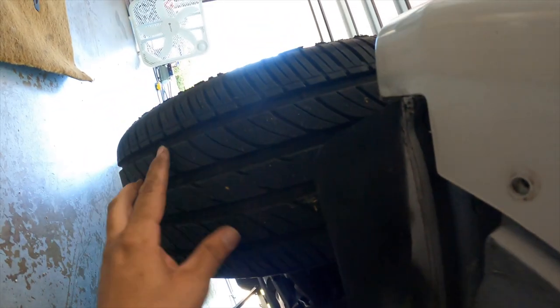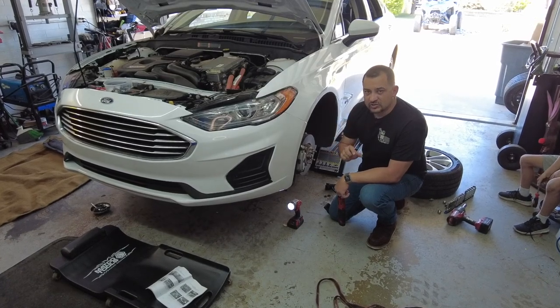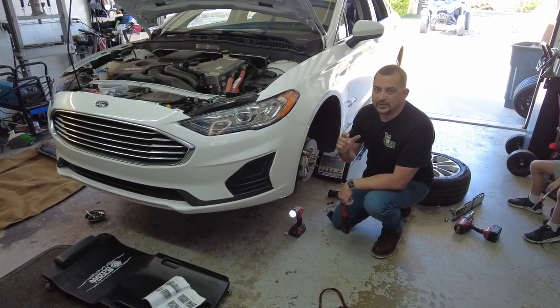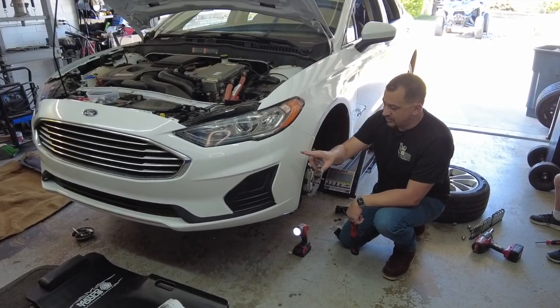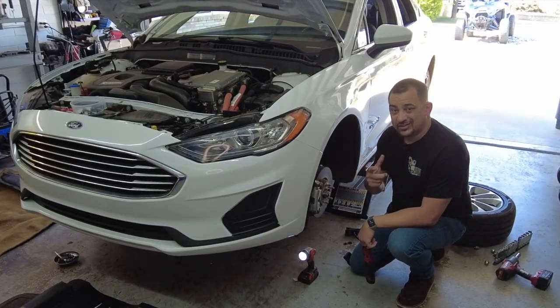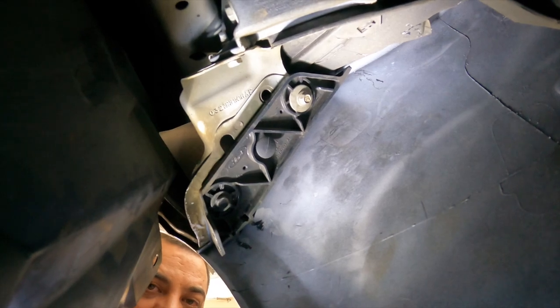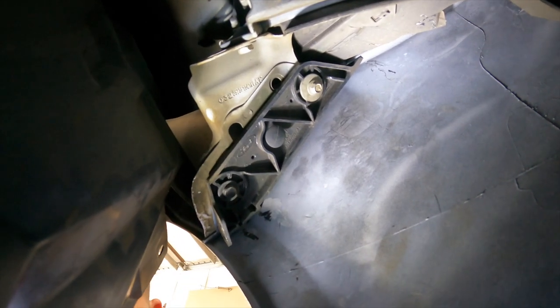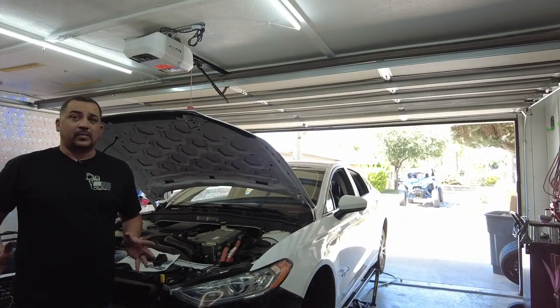This is the little flap going in front of the tires — they're hidden back here. Next thing we're going to do to get this bumper off: there are two eight-millimeter bolts basically right here on the bumper. I'll try to get the GoPro in there to show you. Right there are those two eight-millimeter bolts we're going to pull off. Just like that, the bumper's off.